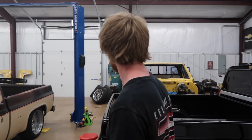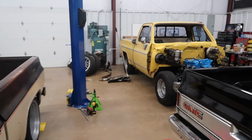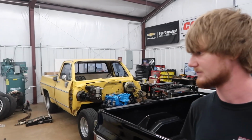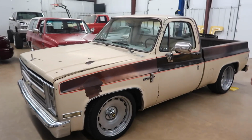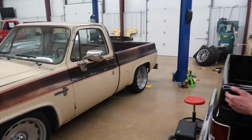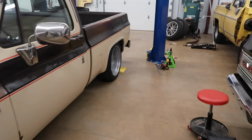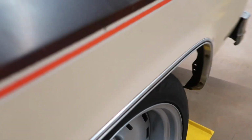They were originally going to go on this 79 Bonanza over here when it got done, but they were kind of tempting just sitting here. They fit this truck well, this color. So we ended up putting them on here. They're both 20s all the way around: the front is a 20x9, the back is a 20x11 with a 5.5 backspace. This is about the limit for these wheels. We have barely a hand right here, and the other side, I think...